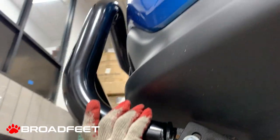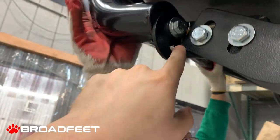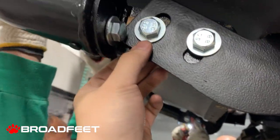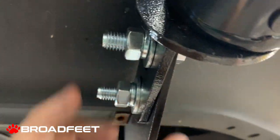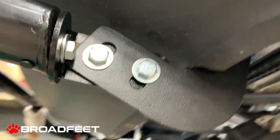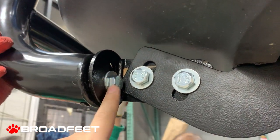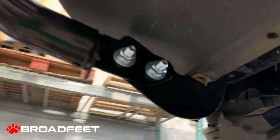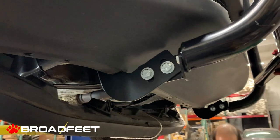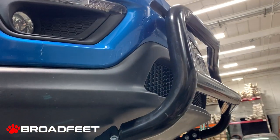Now, installing the bar. We already put this in, and the legs are here, so we tighten this with a bolt, washer. The brackets go in between, and then a washer, a spring washer, and a nut. So we're using a 19 millimeter socket for this, and for this, we need to tackle with a 19 millimeter wrench. So adjust as you go. Make sure it's not too close, too far, and it is to your liking.